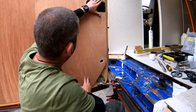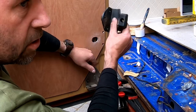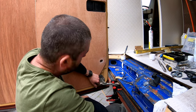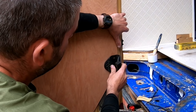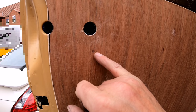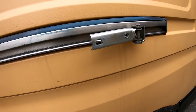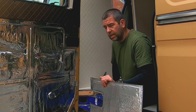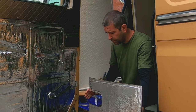I'm going through the bottom door again making sure the panel lines up and everything's okay. The one thing I did forget was my door stop — I want to make sure that's in place because I do not want to see this door fly off. I've made an oval there so it's adjustable. There are also two port holes here which will be left exposed for the end runner for the other side of the door. That's the locking mechanism all sealed up — if I need to go back in I'll just use a Stanley knife and cut it open for any maintenance.